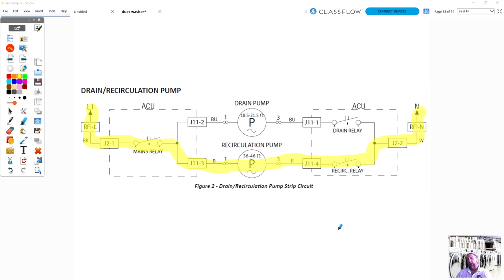I highlighted the circuit for the circulation pump, and in a different color I highlighted the path for the drain pump. The reason I'm pointing that out is because when you're troubleshooting, I don't want anybody to go into a machine and say 'it's not draining, I'm going to tear the whole machine apart, go down to that pump, and check it.' We can check the pump from the board. Notice I have two different circuits highlighted — one in yellow and the other in light blue.